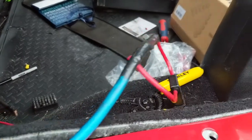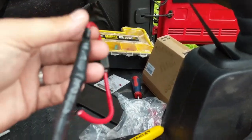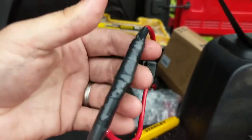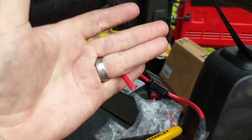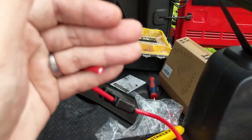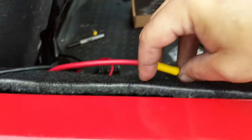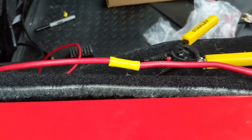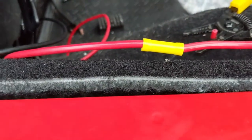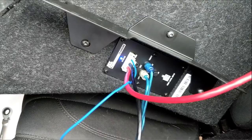Since we're using the existing 12-volt feed, I went ahead and put the fuse that comes with it on the end here. I've got a splice with a barrel connector taped down nicely. I'll splice this onto the connector that goes into the subwoofer — it's a simple barrel adapter. Turn the key to the accessory position and ignition — I've got a good status light. I'm going to turn on some music in a second to see if it plays sound properly. It looks like it's all wired up, and after a good test, I'll mount it.